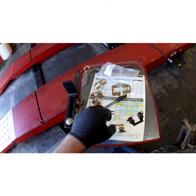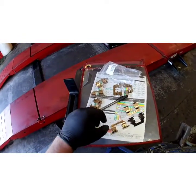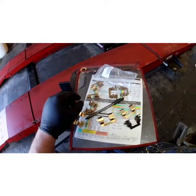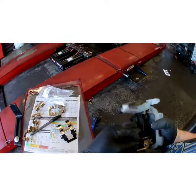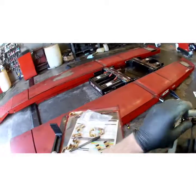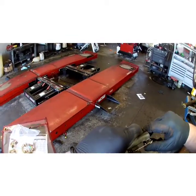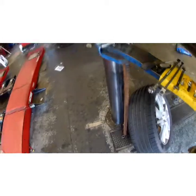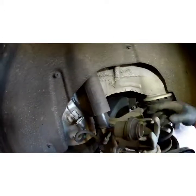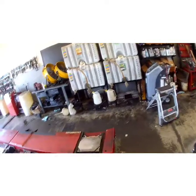Match it up with the old hardware. I think that's it. Make sure it seats good — don't scrub the rotor. Now I'm going to grease these slides. Normally if they look good I don't, but they look like they're starting to get a little dried out, so pardon me while I go find some grease.